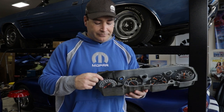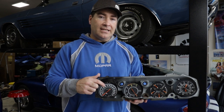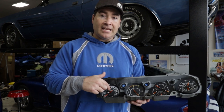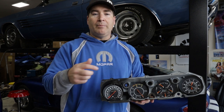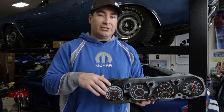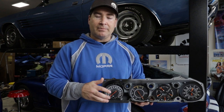On mine I do have a good needle because I already replaced it. The Instrument Specialties needle just adheres to your broken-off needle, so you don't have to worry about removing the old needle, replacing it with a new one, and potentially damaging your speedometer. You just take out the remnants of the broken one sitting in the bottom of your speedometer and glue on the new needle.